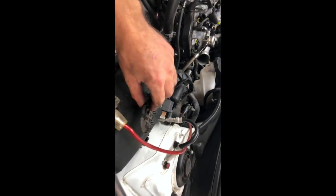In order to do that, there's a cap inside the fender that goes here. We pop that cap out, and voila, there's those two bolts. We're gonna pull those bolts out right now. To pull those bolts out, I think it's a 14 millimeter, and if I'm not mistaken, these ones are almost 80 pounds. So you're gonna use a breaker bar with an extension on it to get those out. So I'm gonna do that now.